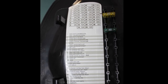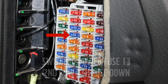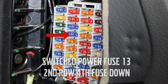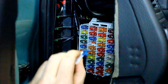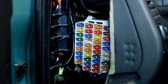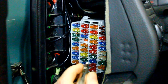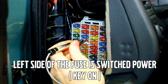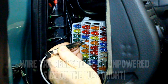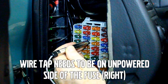There is a list and diagram on the inside of the fuse panel door. On the car shown, this is fuse 13. Remove the original fuse. We are using a test light to find which side of the fuse socket is powered — the left side is powered in this example. You should provide protection for the gauge circuit by putting the wire tap on the unpowered side of the fuse. If you install the wire on the powered side, the gauge will not be fuse protected.